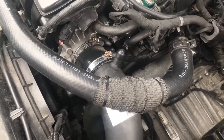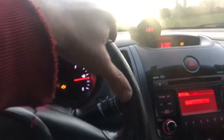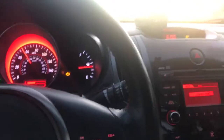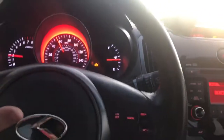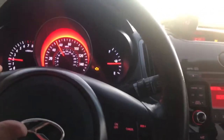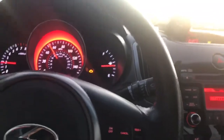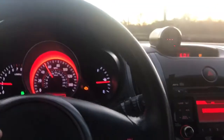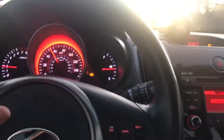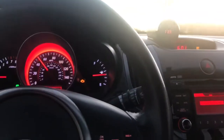As you can see, the bypass seriously reduces the temperature of the throttle body so you don't have air passing through that hot throttle body anymore and heating it up. I made a video a couple years ago about a throttle body cooling bypass. After seeing the results, the throttle body was still about 60 degrees after a 30-mile drive, and the line that would normally feed the throttle body was about 170 degrees — a hundred degree difference.